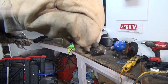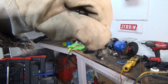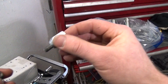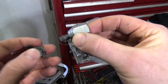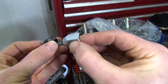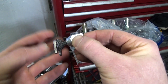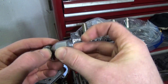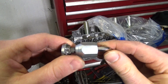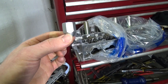This is the finished product, all cleaned up and ready to go. If you have a slide hammer or something similar, that's what you need for this to work. You slide the bolt through an attachment on the slide hammer, then thread it onto your nut. I used an allen key bolt — it has a narrow head so it fits inside and you can still tighten it down.